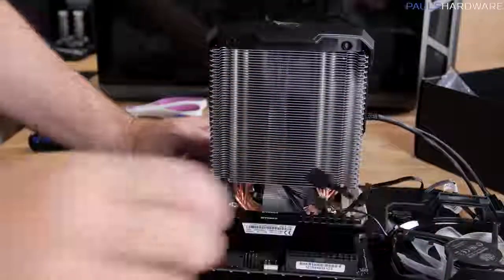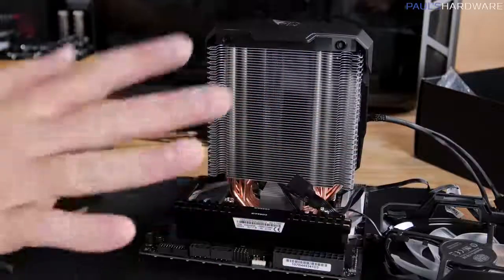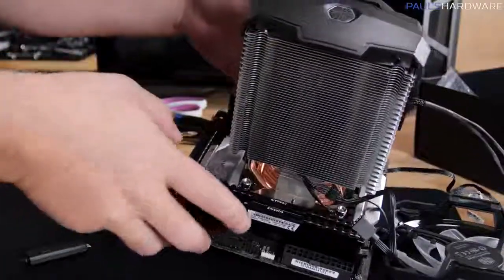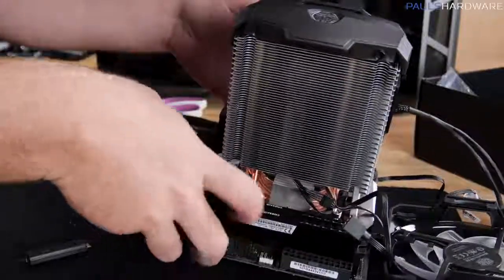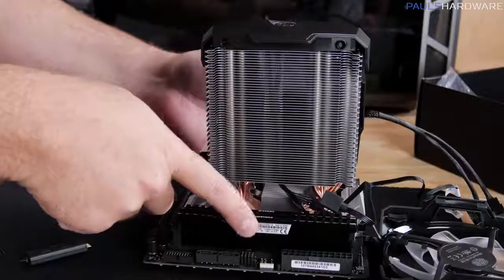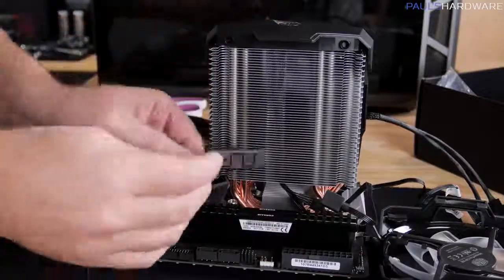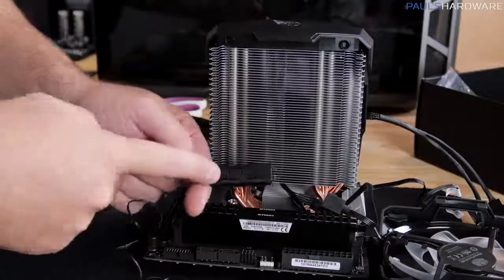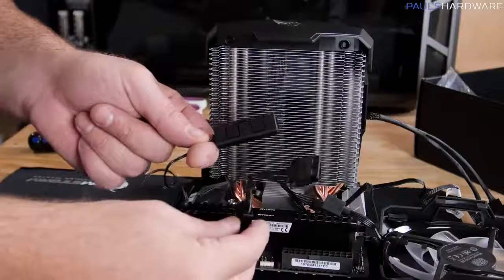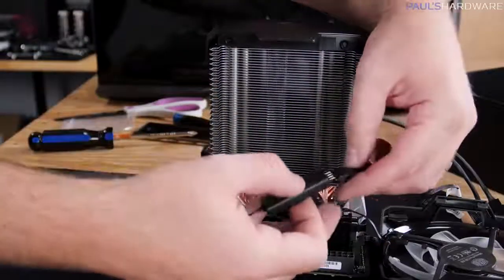But I cannot just plug that into that. It will not work. So I'm going to be going with Plan B, and again, all of this could be easily done away with by just going with a full-size ATX motherboard that has more room for the memory and more RGB LED headers on it. My Asus Strix X299 board, for example, has this header as well as the 4-pin headers. But anyway, our Cooler Master Air MA610P cooler does come with a little control unit, with just a Molex plug. So we're going to plug into that so we can at least have the LEDs going on this unit.